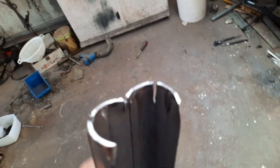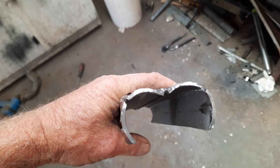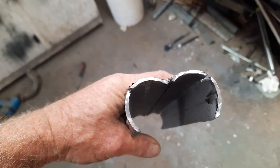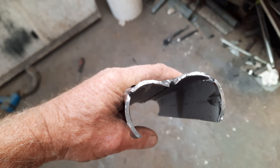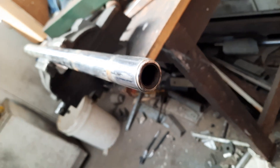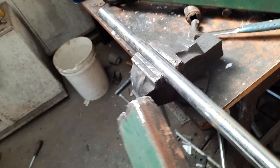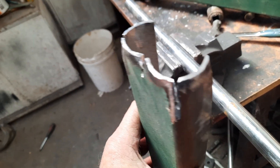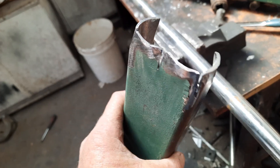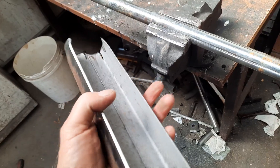I've folded these in and got them prepared. This is 3mm steel tube, inch and a half - you can't bend 3mm tube around inch and a half tube, all you can do is cross the tube. I found another bit - this is motorcycle fork tube - but it's too thick, won't bend, just put dings in it. So I put a few cuts in there and I'll fully weld and clean them all up before I tack it on. There'll be a top going on that as well.